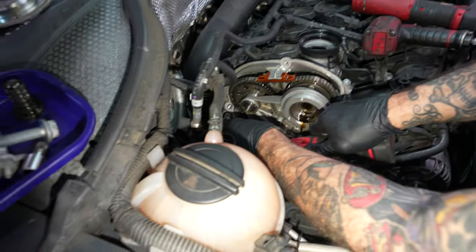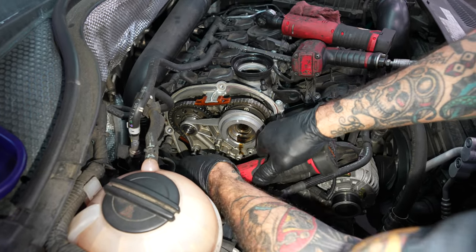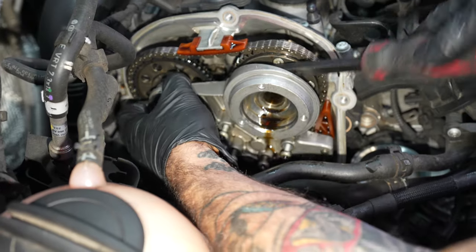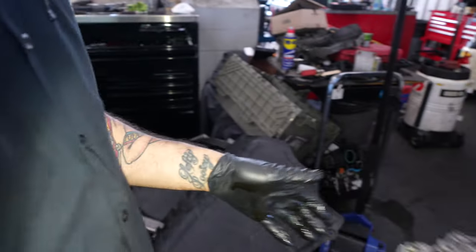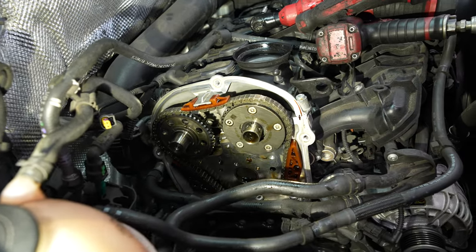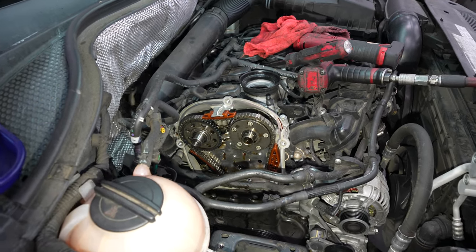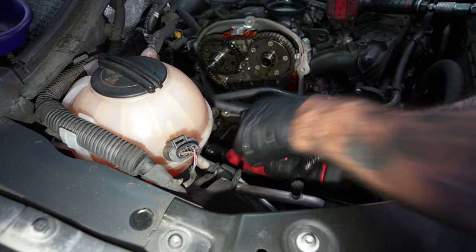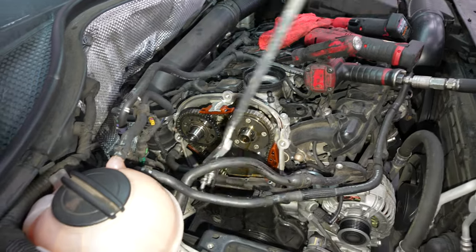T30s to the bridge — cam bridge. The screen's broken, we've got to replace it. So why doesn't this chain have the copper links on it? It does. They're only going to line up every 163 or 164 times. We've got to replace the chain, the guides, and the tensioner.